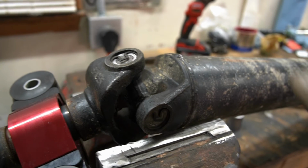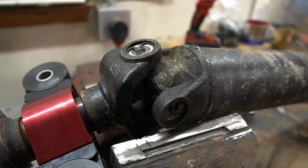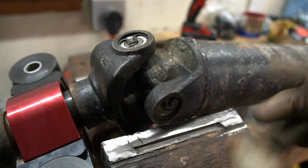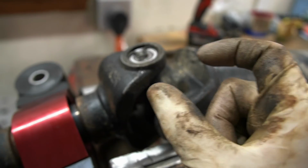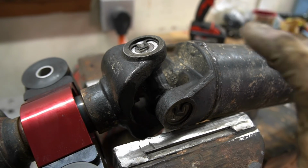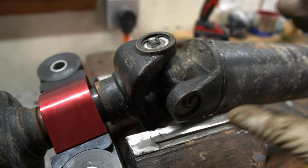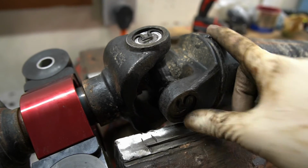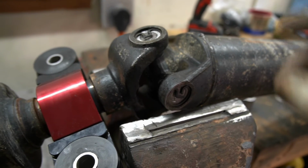As I mentioned before, if any of your joints felt a little stiff, if there's any roughness, I would be worried you dropped a needle, but if it's just a little stiff, that means it's tight. So what we're gonna do is support the opposite side of the cap that you wanna push out. So just like we're going to take it apart, except for with the clips in. And when you're doing this, you're making sure the caps are as far up against these clips as they possibly can be, and that leaves enough room for the U-joint to not be compressed in there and be real stiff and tight. So go ahead and do it set up like this, flip it 180 degrees, give it a few taps, and then move on to our other side, and then we should have a nice, free, easy to move U-joint that's not stiff or gritty or have any rough spots.